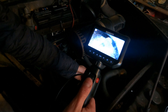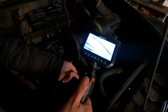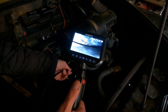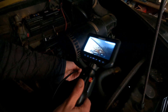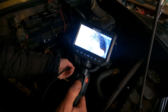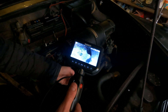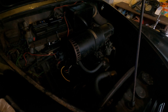Let's have a look in there — we can always open up another one. I'm just going to move that camera around, and yes, we are pretty much at top dead centre here. There's something on the screen there — we do have some vertical scoring marks. Let's twist it the other way; it looks a bit wet as well. Twisting it to the sides — yeah, that looks like a bit of oil on the top there. So we've got some vertical scoring marks and we appear to have a bit of oil on top of the piston. This engine hasn't been started for at least a week.